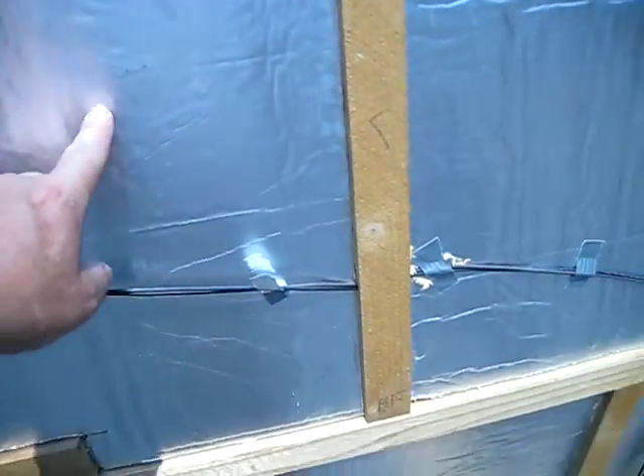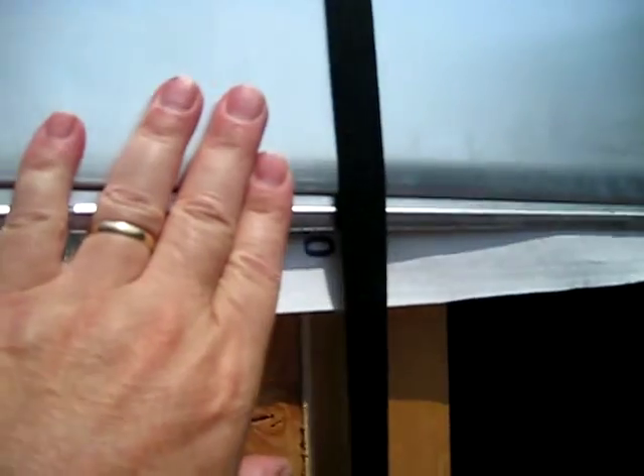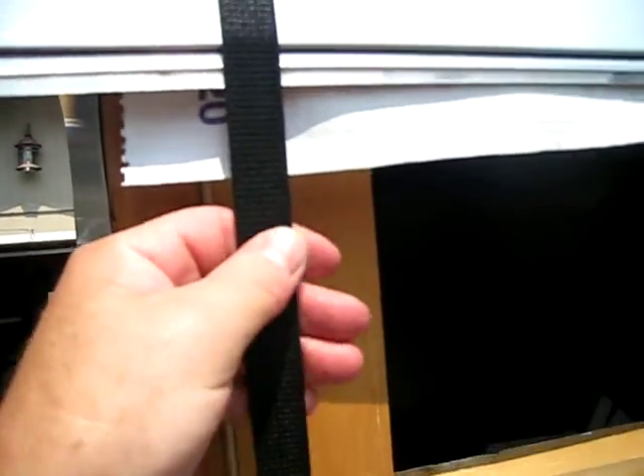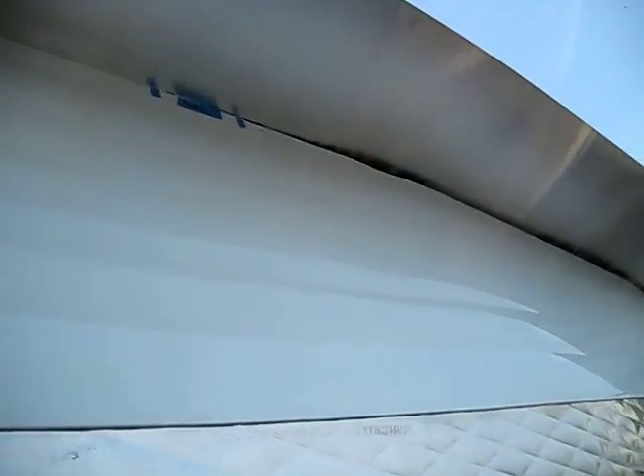This insulation scheme gets the reflective bubble wrap, and then the skin will go on the front and the rear — they get snapped into these S-locks and stapled down. Right now I have the roof strapped down with one-inch webbing. This is basically the way that Mobile Tech puts his roofing on — if you want to know how it's done, you can go watch his videos. It's ratcheting down in the hot sun, taking the shape of the trailer roof. It's going to be a challenge to get it cut and bent over and stapled in without too many ripples and buckles.